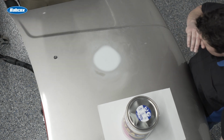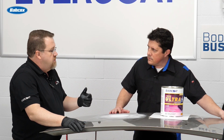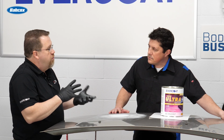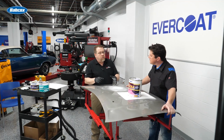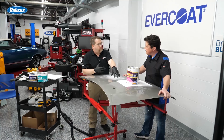I know, Tim, we were talking about putties and fillers earlier, and if this is a filler, how are you able to do that? Oh, that's a good question. Well, I was talking about the differences in the resins. This particular product uses a resin we call eco resin. It's a polyester resin, but it's blended with our own proprietary patented process of the new eco resin. The eco resin gives us a wider range of substrates, so it's able to go over top of a sanded clear coat, something that was unheard of for many fillers.